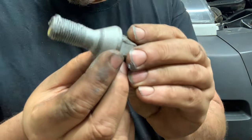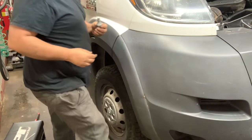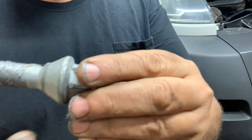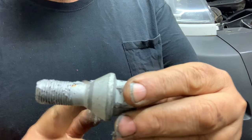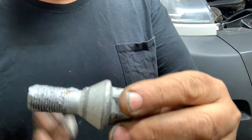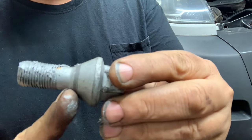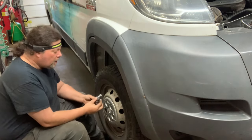Here's the science of it. See this bolt? It's a beefy piece of metal. The important thing to know is that what takes the vertical load when this is clamping the wheel to the hub is the pilot area here. You can see it's concentric, so it self-centers. Even if this fell out, there's still a lip that the hole in the center of the wheel would grab onto. The vertical load is taken up here on the lug nut — not by the force of it going in, but by the clamping force you're putting on with the lugs.